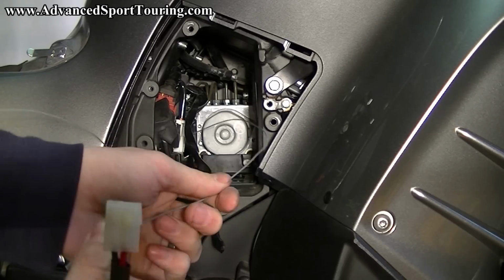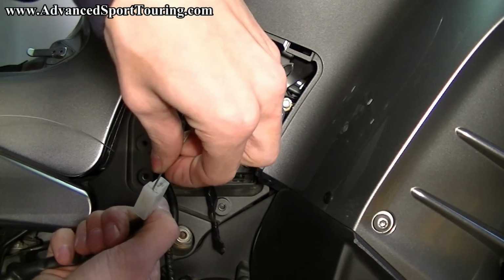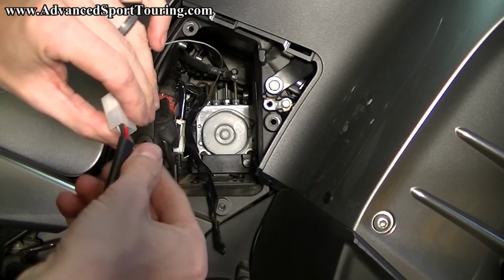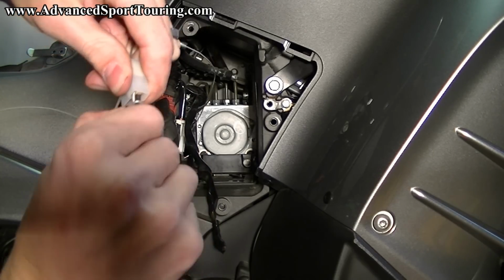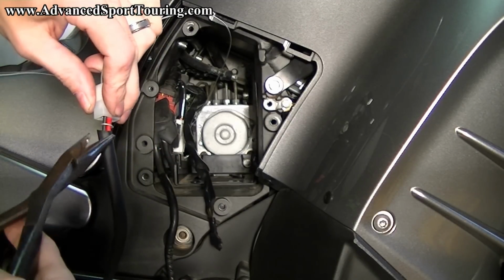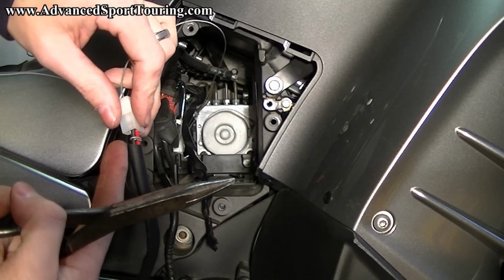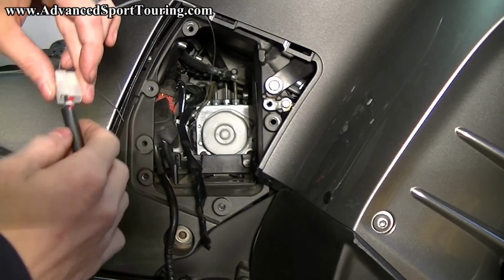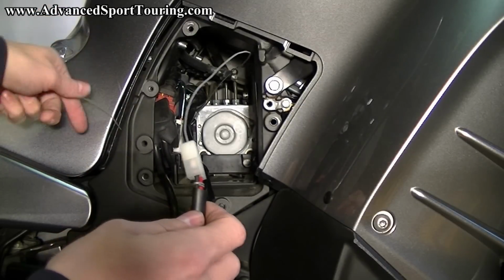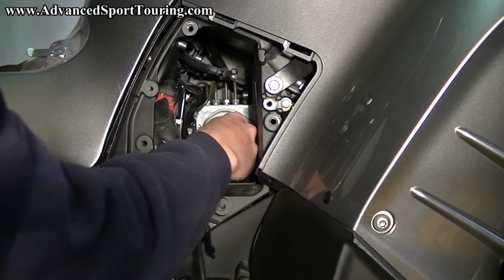Take the wire that you just fed into your battery compartment, feed it through either of the connectors until it goes all the way through, and then wrap it around the base. And then take a pair of pliers and completely bend it so that the end of it isn't sticking up. We don't want that catching on anything. This gives us a secure connection for when we're going to be pulling it from the battery compartment through this hole here. So go ahead and slowly pull on your wire, and it'll start to feed through the battery compartment.